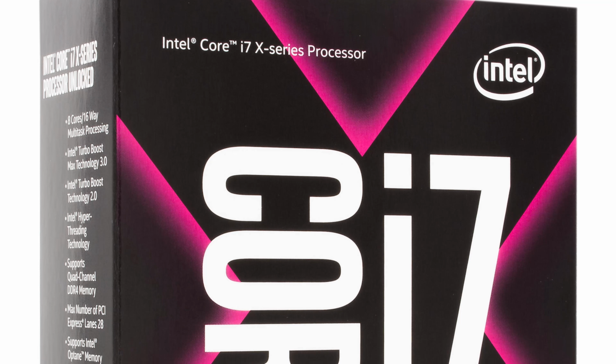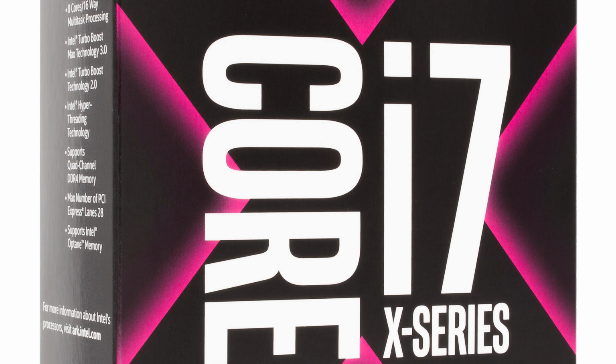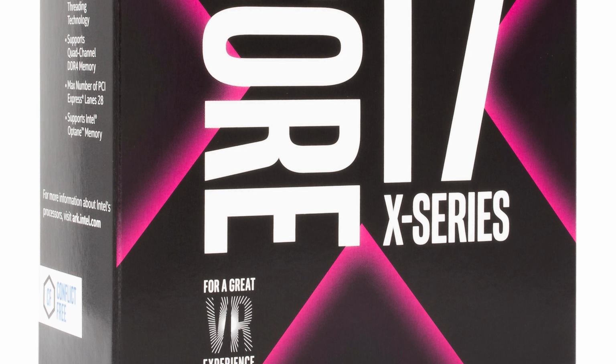The 8-core CPU with this motherboard is basically ideal for two reasons. One, the 8-core has a restricted number of PCI Express lanes, so you're not going to be running a lot of peripherals anyway, and power consumption. Now, you can run the 10 and the 12 core, it's totally fine. Like I say, I ran the 10 core, overclocking was totally okay.